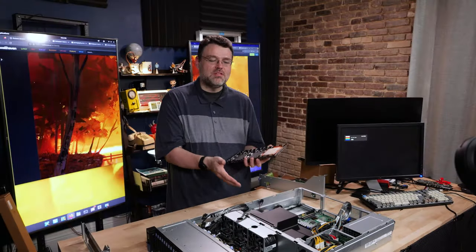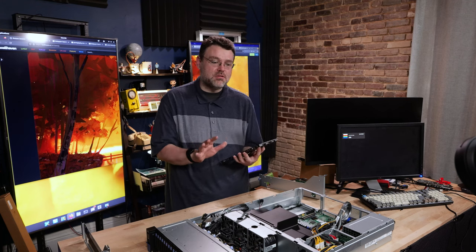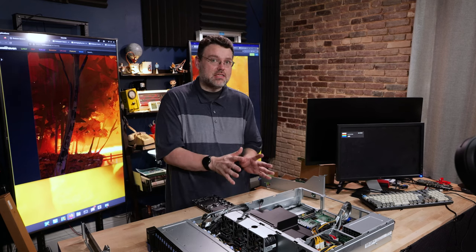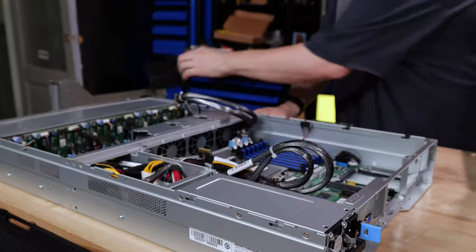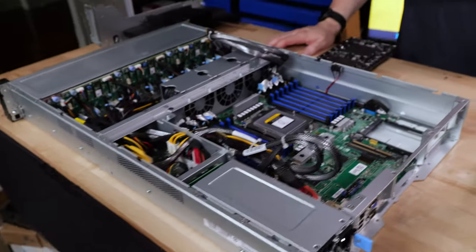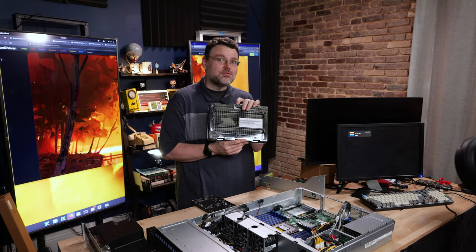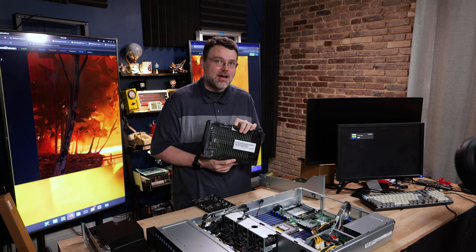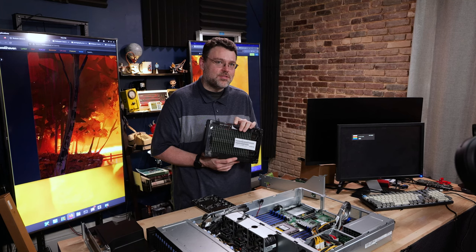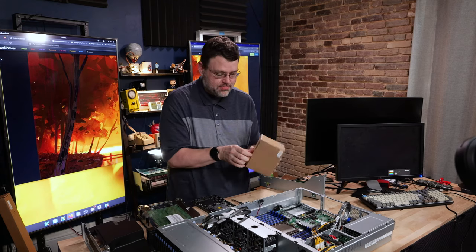I mean, the DDR5 platform and the PCIe 5 platform, even though I'm mostly using PCI Express Gen 4, all of those things really help this build tremendously. The other thing is, this is one of the first platforms that I've gone hands-on with that is two DIMMs per channel. And I bought, with my own money, $3,500 of memory in order to be able to test two DIMMs per channel, DDR5 4800. Uh-oh, there's somebody at Tyan sweating a little bit. It's probably fine. We'll know in a minute. We're going to wait to install the memory just a little bit longer. For now, we need to keep it cool in here.